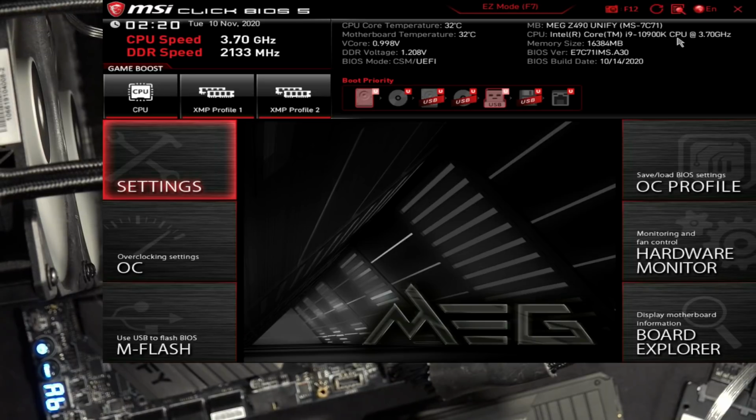I think is necessary. So hopefully I get it all in one take. We're going to be going through a couple different memory configurations and how they overclock with the MSI Z490 Unify. The point of these different memory configurations is that we're going to be looking at dual rank and single rank setups with the exact same timings and exact same voltages. And we're going to look at the performance and how they can overclock.